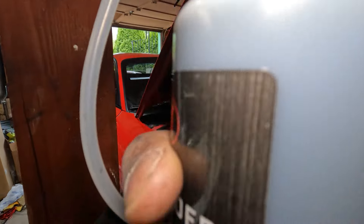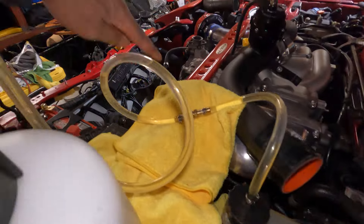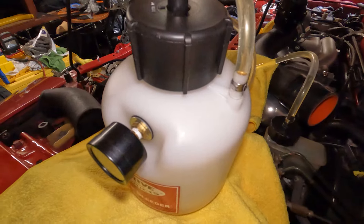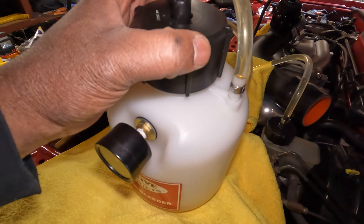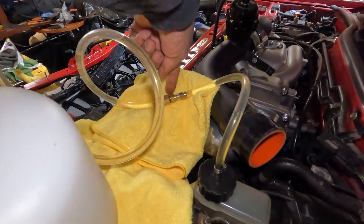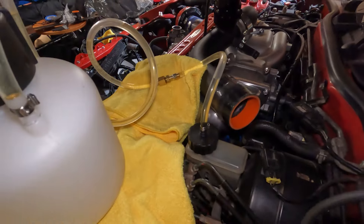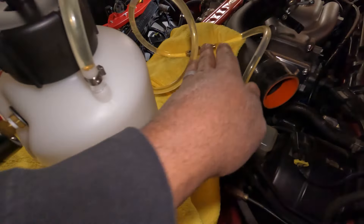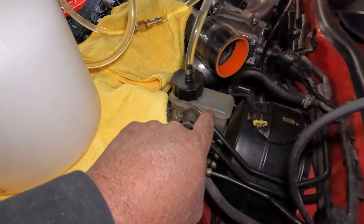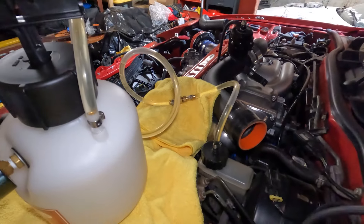To disconnect, don't loosen it here first — that's bad news. Similar to when we did the pressure test for leaks, you want to loosen it here to depressurize first, then loosen from here and make the disconnect. I'm probably going to leave it together and coil it around the canister. Be sure to have some microfibers around because if this brake fluid gets on your paint, it's game over. The level is not at max so I'm going to drain some out into an empty bottle and top it up.